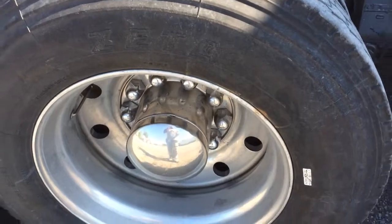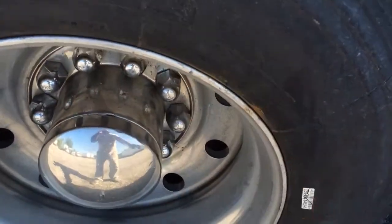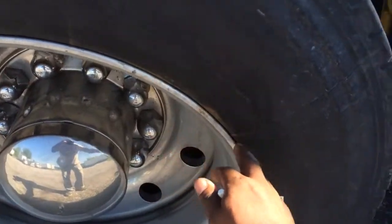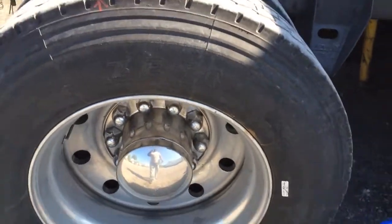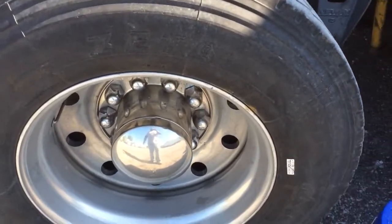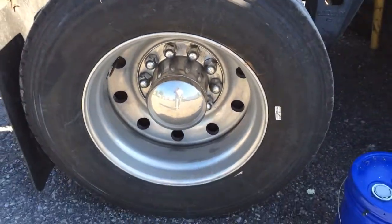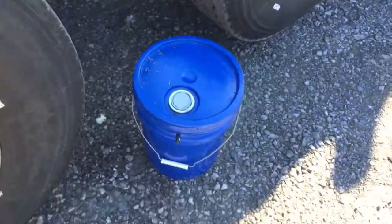You could see what was going on inside the tire. It was also trying to seal up around the bead because when your tire is off the rim, a lot of shops don't take a grinder out and clean where the bead seats. Sometimes it's bumpy with debris, so it doesn't get a good bead when you put the tire back on, and over time it will leak. So make sure if you get your tires taken off, they clean around the bead where the tire seats. I got that bolt plugged up.